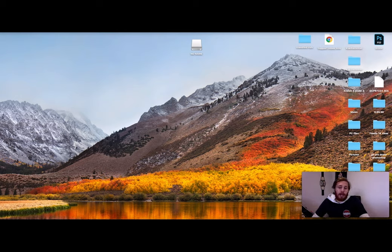Now, yes, it did come out of an old PS4 hard drive, but each PS4 is paired specifically to itself. So if you get a hard drive out of a fat PS4 and put it into another fat PS4 or a slim PS4 or a Pro PS4, it's going to format the drive completely and reinstall a new version, because the onboard processor is linked directly to the hard drive. It was the same with the PS3s as well, so you couldn't just take a hard drive from another console and put it into another one, because it just didn't work like that. You always need to go back through the process.